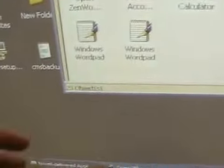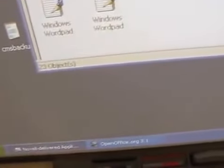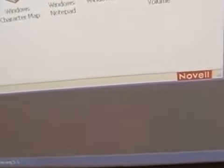So we get into a situation here where every time you turn on the computer with your Smartboard, the Smartboard is misaligned by an inch and a half to the right of where it should be. And so this irritates the teacher, and they reorient the board and do the touch and get it all aligned. And then you run a program that for some reason changes the screen resolution to 800 by 600 or whatever for some other program. And now all of a sudden the orientation is wrong because they had aligned the board for the wrong video signal. And so now that you have the right video signal, the previous alignment has now messed up the alignment. And so you have to reorient the board. It drives people crazy. And at the moment, I don't have a solution to this.